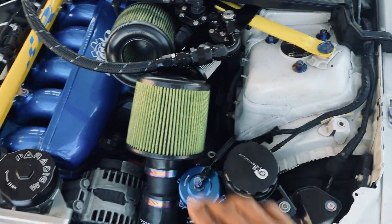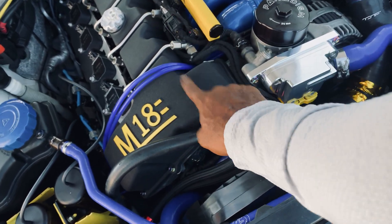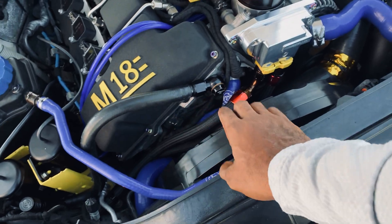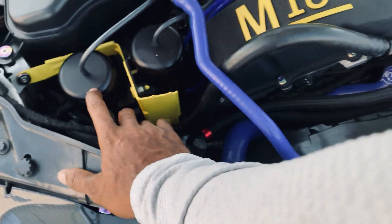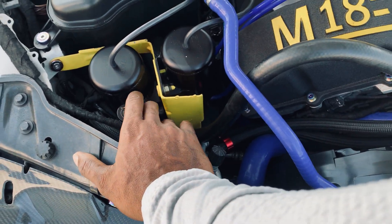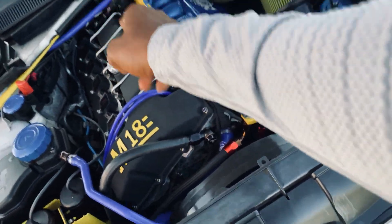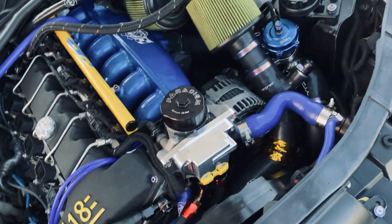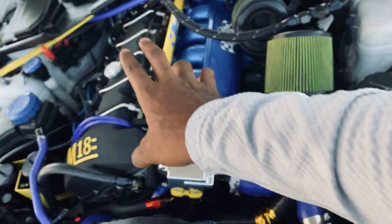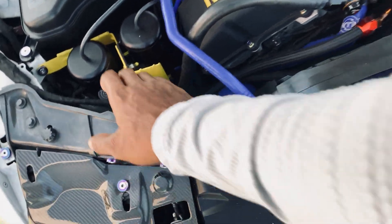While you have the high side and low side set up, you also need to regulate the vacuum on the crankcase, because it will become very excessive. I have a bung running into the head of the engine with a hose and a relief valve — this is from Vargas as well. You need this installed to regulate the vacuum, because too much vacuum will cause it to suck in on the seals — the rear main seal, front main seal, all the weak seal points. You'll start to hear a whistling sound. I have this regulating at least 10 inches of mercury of vacuum on the system.